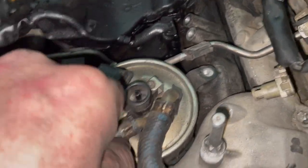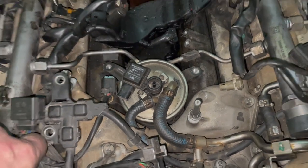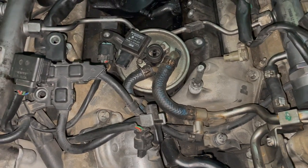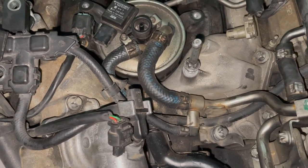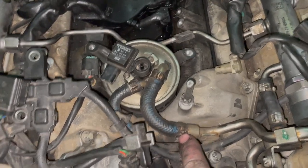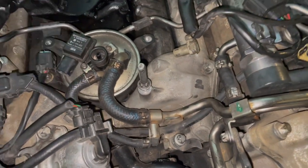The filter is loose now. These clamps are one-time use — I watched a video made by ID Parts. They need to be pried off, and ID Parts recommends not reusing the same type. These are single use, so once they come off they're done. I might have to replace those pieces of fuel line and use screw-tighten type clamps instead on the new fuel line, so they're easier to remove next time. I'll have to figure out which lines to pry off, and then the fuel filter will come out.